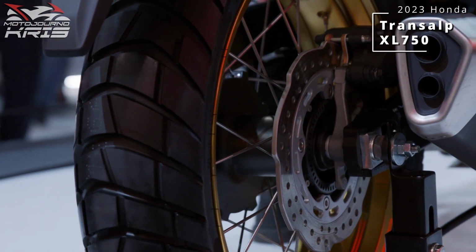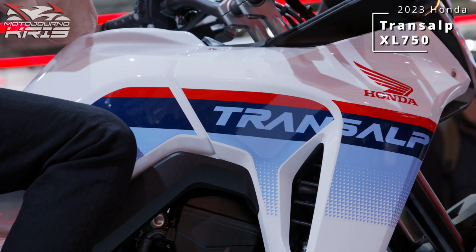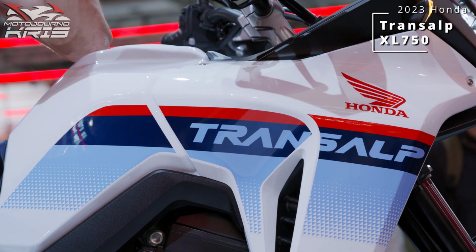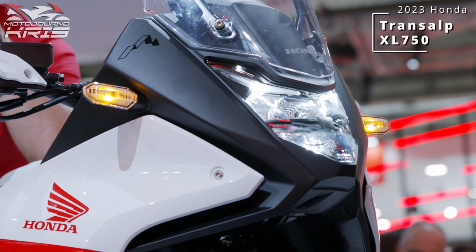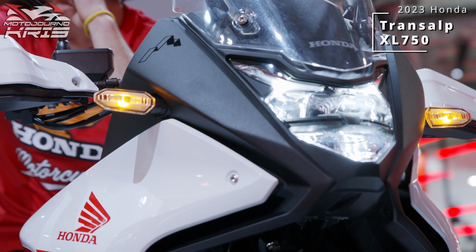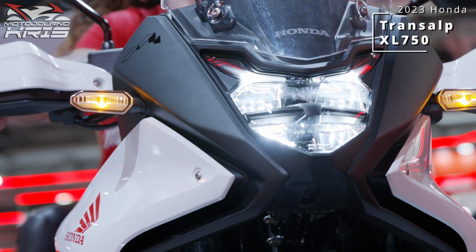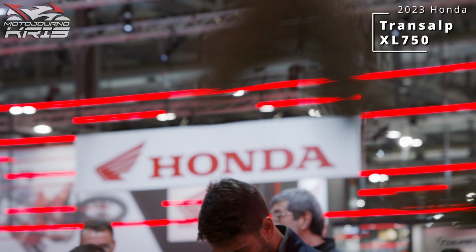The Unicam head design comes from the CRF 450R, which keeps the engine compact with no balancer drive gear, thanks to the primary drive gear also running that balance shaft. Vortex flow ducts are run with downdraft intakes and 46mm throttle bodies, while cylinders are NISIC coated, as on Honda's performance machines. An assist and slipper clutch is also run with FLS discs, apparently reducing drag torque by 30%, making for a lighter lever and easier upshifts.